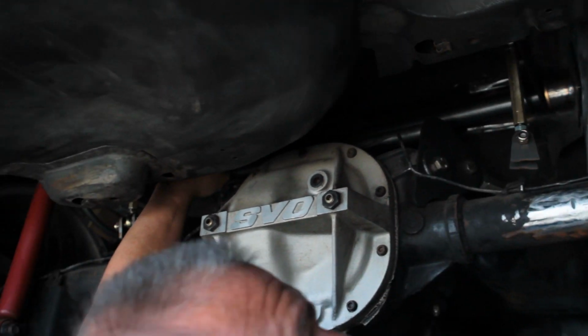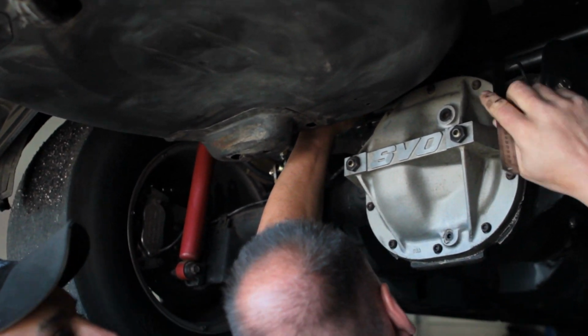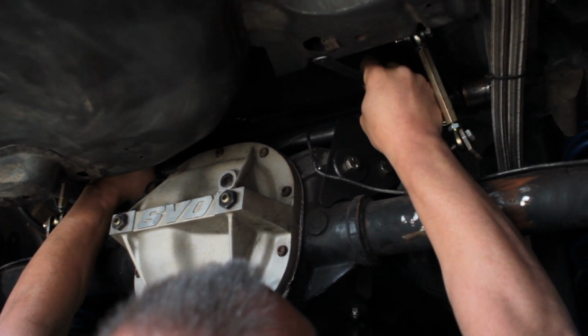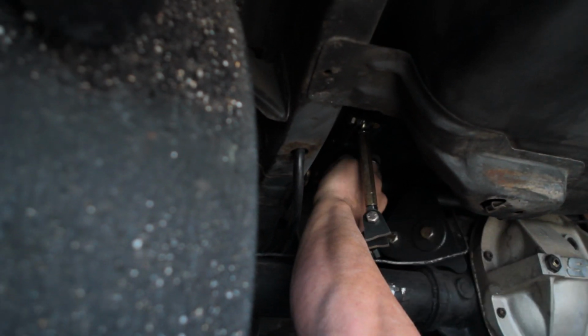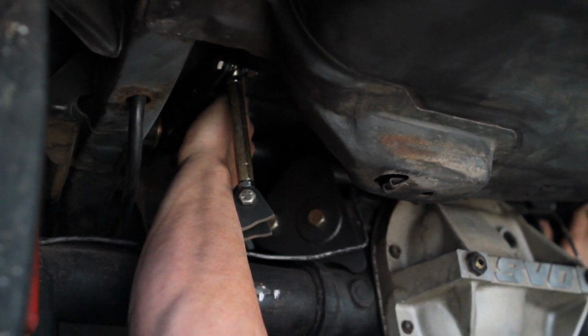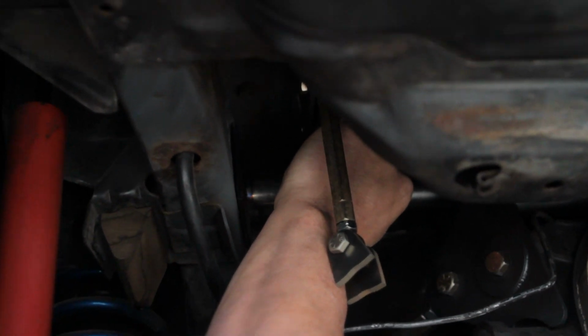It's really easy. And then, you know, we just check a couple measurements. There's a bulkhead up here for your upper torque box. Right. You wanna measure it to make sure it's square. You know, you measure side to side. Right. Here, I'll move over here. Side to side to the center of the bar. Right. It's a little bit off. So we go from the bulkhead to the center of the bar. Yeah. Okay. And it's a little bit off on that side, so you just wiggle it and replace it.